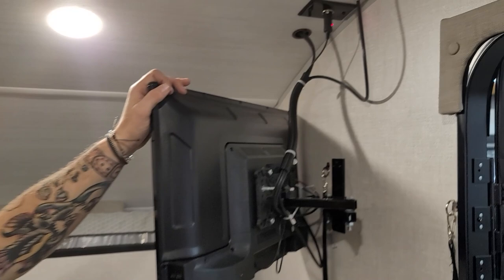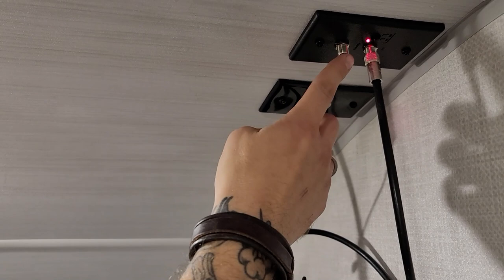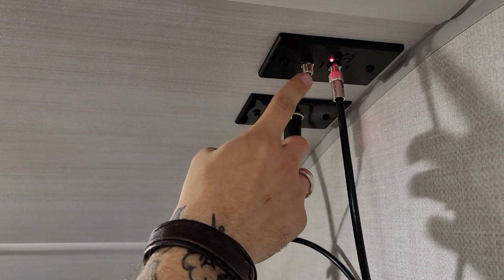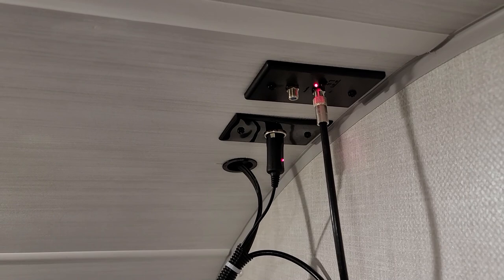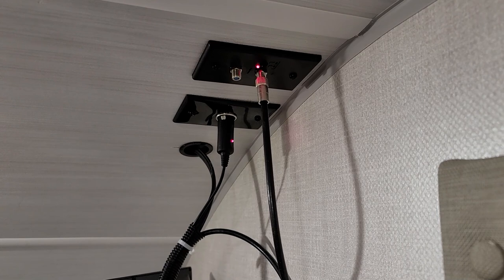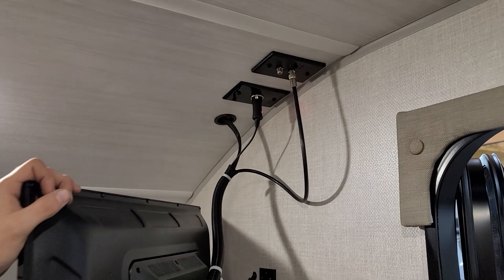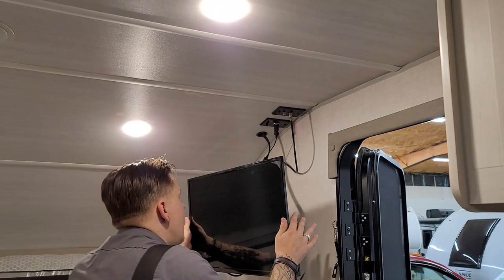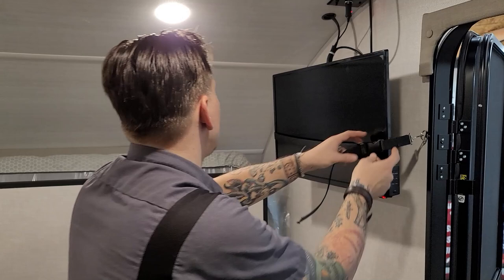Looking at the cable connections here, this one is the outlet from the external cable connection we saw to feed either an aftermarket satellite package or a park cable service to the unit. This other one corresponds with the rooftop omnidirectional digital over-the-air antenna. To take advantage of that, make sure you turn that antenna booster on — if you see that red light on, do a channel search on the TV to bring in any over-the-air programming. If utilizing a park cable service, make sure that antenna booster is turned off so the cable signal can pass through the line. When getting ready to go down the road, make sure you buckle your TV in to avoid any damage.